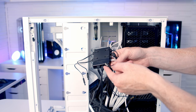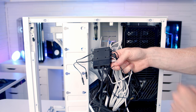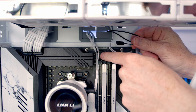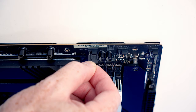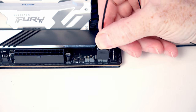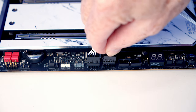Alternatively you can leave this cable out and just use Lian Li's L-Connect software, but I'll show you plugging it in for completeness. We'll pass these cables through to the top of the case — I'm going to plug the four-pin PWM connector into the CPU fan header. We've got two ARGB headers at the top right of the motherboard, so we'll plug the ARGB cable into one of those, and then we've got another USB 2.0 header at the bottom of the motherboard where we'll plug in the USB cable coming from the hub.